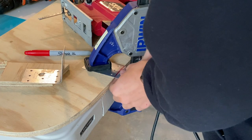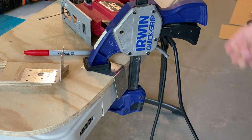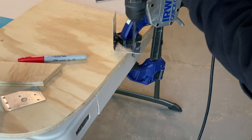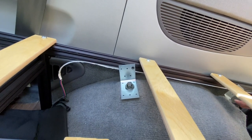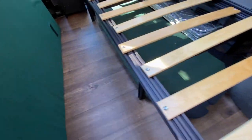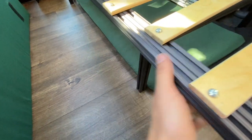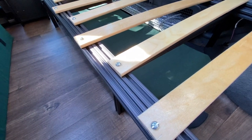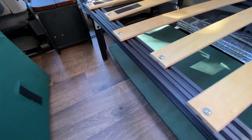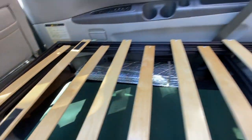Basically what I did, as you can see here, is I just took these flat sheets of metal that had some holes in them already, used a cardboard template to sort of get an idea of the shape I'd need to connect from this screw hole over here to the frame of the bed. And then I did something similar where it's basically the same bracket just mirrored. I was actually thinking of mounting the legs to the floor or the subfloor, like a lot of people do in camper vans, but as it stands right now it's quite sturdy. I've gone off-roading — soft-roading, I should say — with the bed like this and I didn't hear any rattles or any bouncing. But if I do hear anything down the line, I might consider adding a bracket at the front legs and mounting that to the ground.